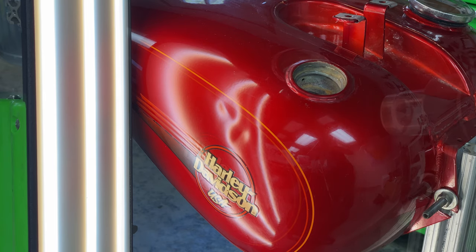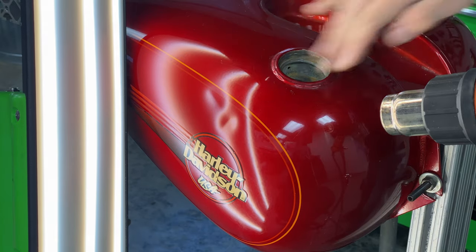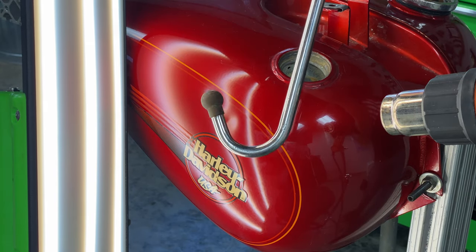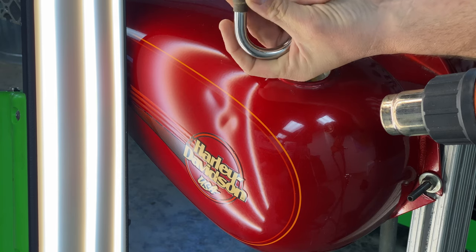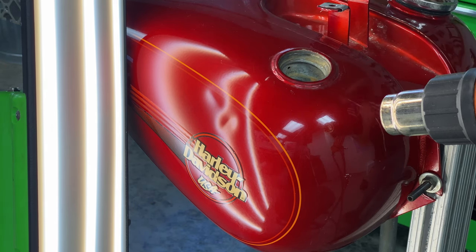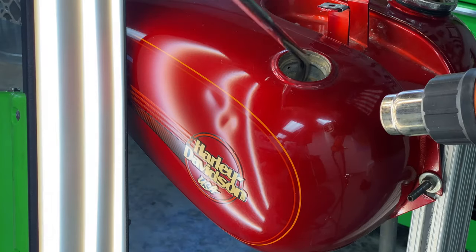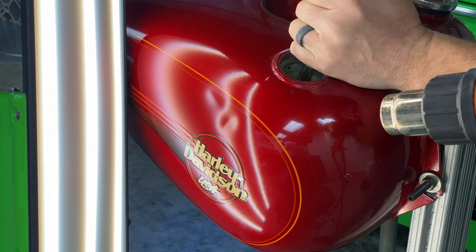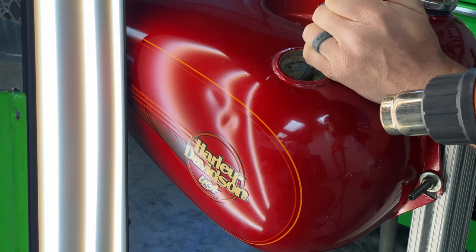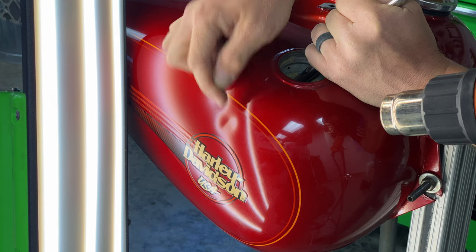And you will be able to see it take place. We've got our heat gun set up and this tank is nice and hot now. As mentioned before, this is the tool we're going to use — I used a wood resin ball tip. It's a real soft tip and it has the right angle to reach these areas. So I'm going to go ahead and get it down inside the fuel tank and over to where the dents are, and I'm going to start slowly applying pressure and reshaping the metal. We're starting over here on this far corner and we're going to start working that dent back.